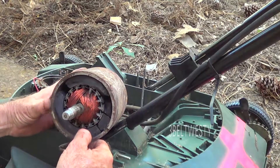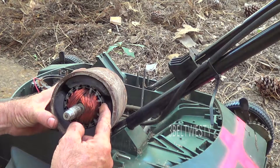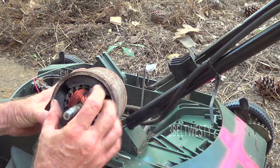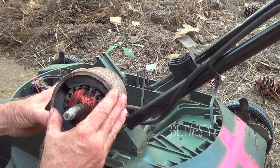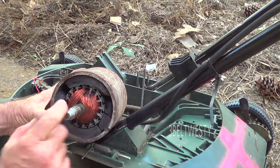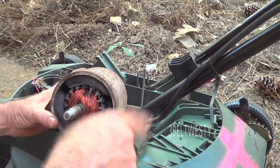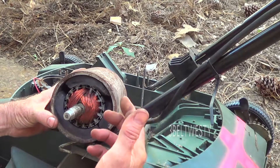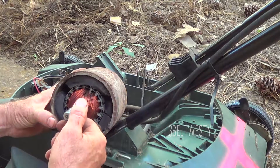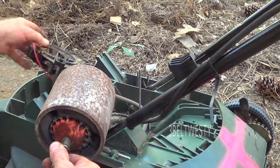I've had this happen on one that went underwater in Katrina. This particular one's 20 years old and I really abused it. What can happen is it can overheat, the glue can de-bond, and it'll start to rub. The characteristic — the reason I'm doing this video — is all of a sudden it'll act like it's running at half speed. That's generally because a bearing can be sort of dry, with a little bit of squeaking noise. If you unplug it and rotate the blade by hand, you'll notice that squeaking. I oiled the heck out of the two bushing ends and it still didn't go away.